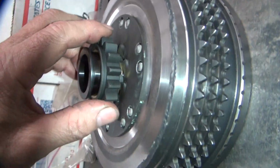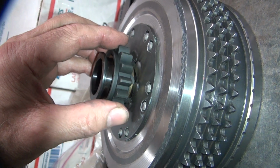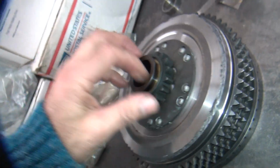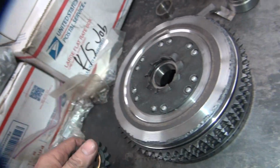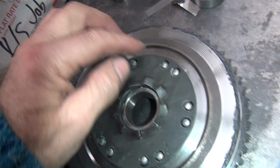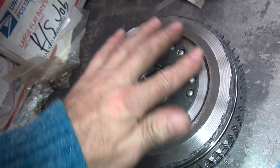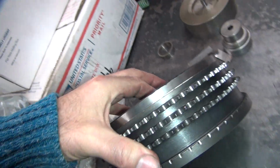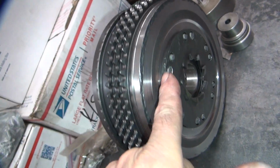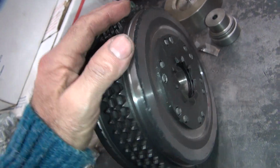Now, when I back cut both teeth, they hook into each other, and I can actually pick the starter basket up a little bit when I do it. So you'll have to grind those later. Anyway, that's how you do that. So some of these don't look quite the best, but most of them look pretty good. Best method I found so far for doing it, and what I like is the plate is definitely 100% against the backing, against the basket.